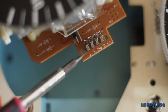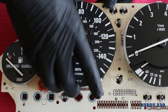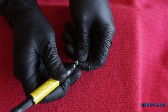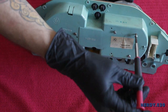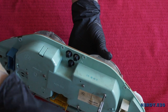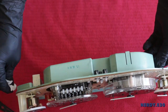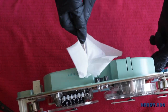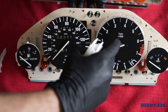Let's identify the rear contact pins that connect the odometer to the main board. Once identified, carefully place it and make sure the contact pins are secure. You can also clean the bolts if they're dirty or oxidized and reinstall them in a cross pattern, tightening by quarter and then eighth turns. Let's give the back of the cluster a quick wipe down — it tends to get very dusty and dirty, so kim wipes, Q-tips, and some Windex will do just fine. Finish off with some dust-off to get all the little debris out.